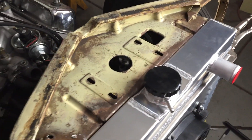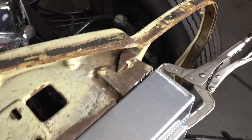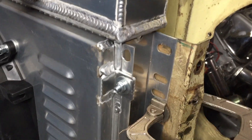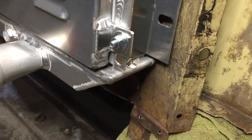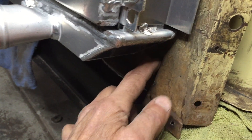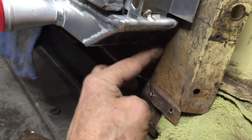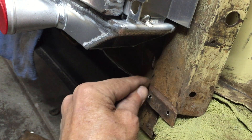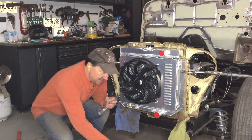That's exactly what I envisioned in my head - got that all worked out perfectly, perfectly aligned, it's even on each end. That was just one of those happy accidents. I've got my flange on both sides - I need to trim that back so it's even with the radiator all the way down. I'll trim up this area in a way that has a nice look to it, and I need to leave enough to weld all on the back side of this and down this edge, so I'll probably taper it up. That'll be reinforcing it there - this is another huge accomplishment.